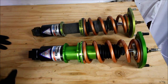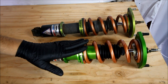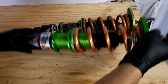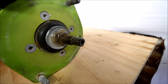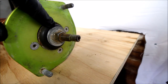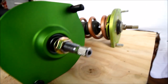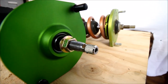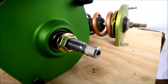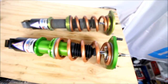Some of the key upgrades: they both have 15 damper settings, but this one — the ultralight — can go quite a bit stiffer. It's aluminum, so it's a very lightweight unit. The old coilover is mounted on a rubber bushing on the top hat — a comfort feature, a little flexy but better ride quality. On the ultralight coilover, it's mounted on a ball joint or pillow ball, which helps with the responsiveness and crispness of handling. Just a bunch of little changes that make this a more performance-oriented coilover.